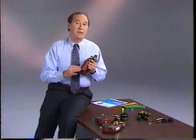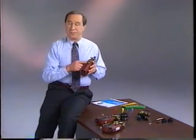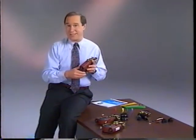To meet a variety of clearance situations, we offer two pawl locations. They're left-handed and right-handed, used together, as well as an unhanded version. Rockwell ASAs perform because they're built tough, with a torque rating of 30,000 inch-pounds. They're sealed against contaminants with positive lubrication to all moving parts for dependable, consistent operation and lower maintenance costs.